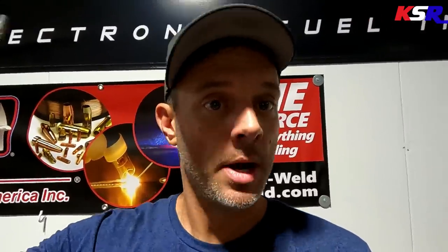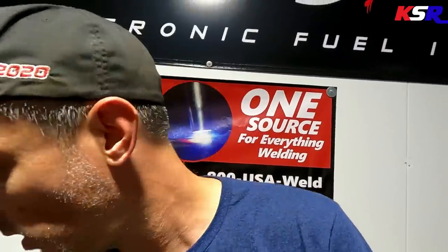So we're gonna put some new spark plug wire ends on the back two cylinders. I think I'm gonna try a 90. See if I can get a 90 degree one to work, and we'll use MSD high temp boots. At least I think I have some MSD high temp boots in my random parts stuff around here. So need a little bit of time to do that, and then we'll make another pull, because I think we're gonna make 700 plus.